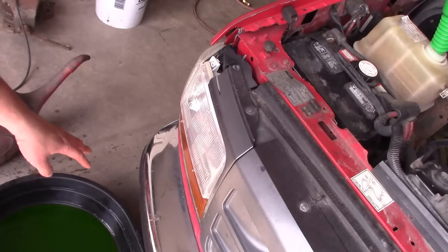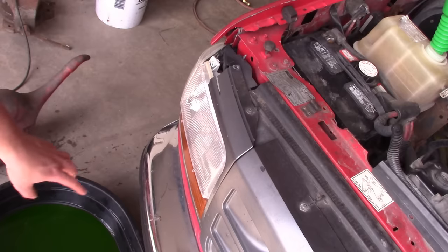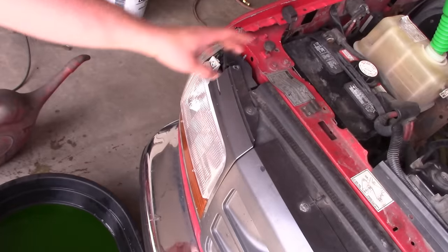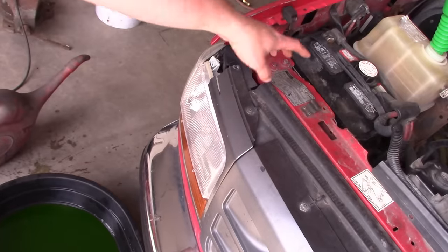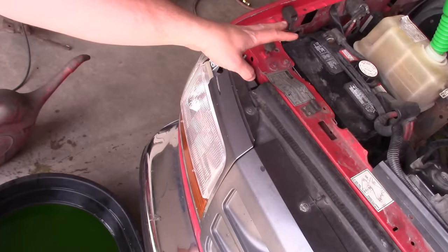In the old days, I used to work in a truck repair shop. The way we would fill the coolant system was to put a submersible electric pump in our catch pan and run a hose up to the radiator or the surge tank, then electrically pump the coolant in. That worked pretty well as long as you didn't have any major air locks.